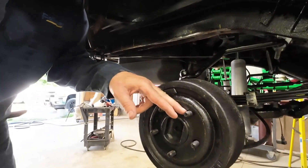The only problem is the aluminum rims are just a little over a half inch thick, and you can see the length on these studs. So I ordered more parts — I've got to knock the studs out and drive some new studs in there. Other than that, I'll keep pounding away at this deal and bring you back when I have those frame rail reinforcements all tacked up and on there, maybe even welded.